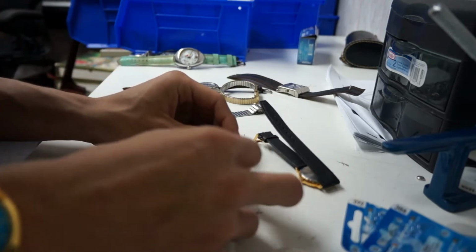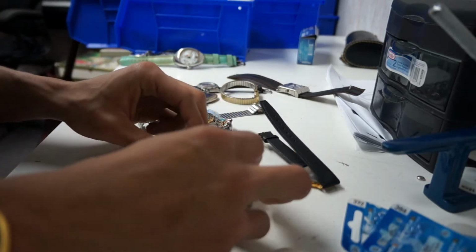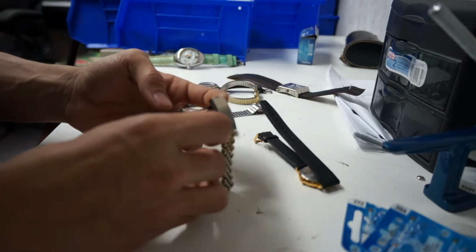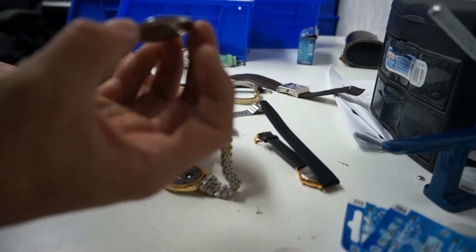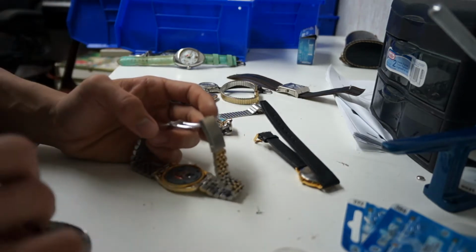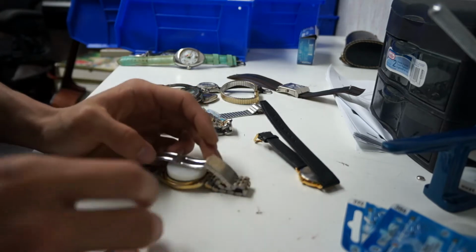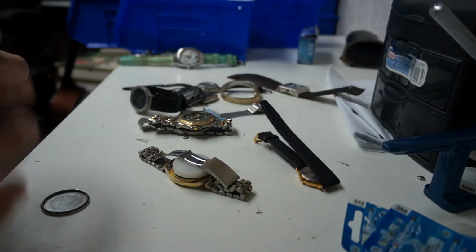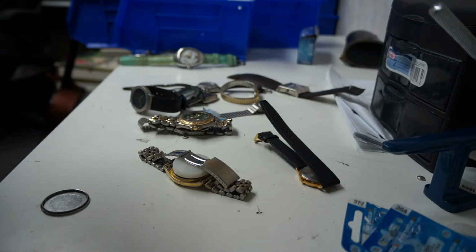I think a small piece of electrical tape on the battery door itself will remedy the issue. So let's figure out what point here would contact the battery and put one there. Not sure why it wasn't like that from the manufacturer. Maybe it was and just got misplaced or something. But it's definitely an issue. Definitely not looking to repair a lot of watches, but if it's that easy to repair and I can try it out, I might as well.